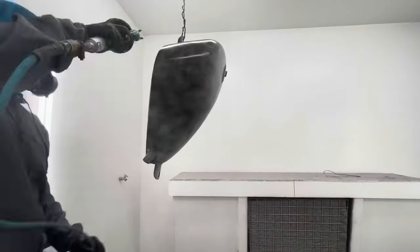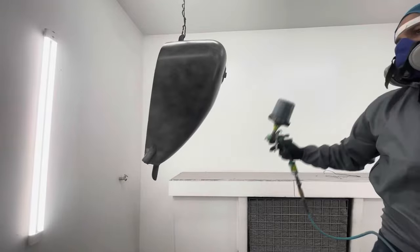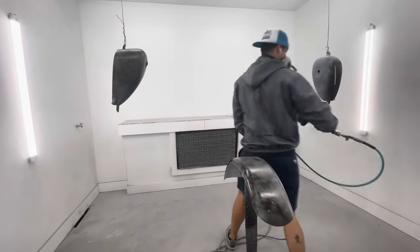Here I am laying out the first ground coat over a 2K primer. As you can see, I don't go for full coverage — I just pretty much dust it on. You don't want to throw it on too thick, especially at first.